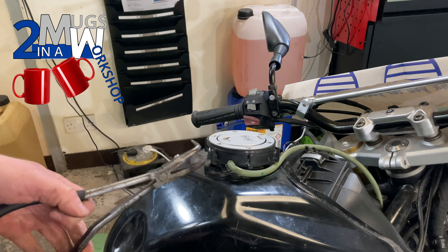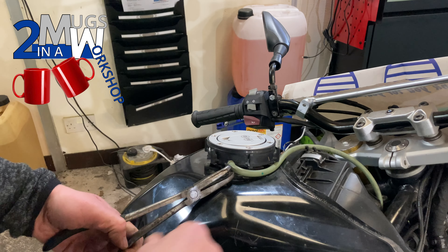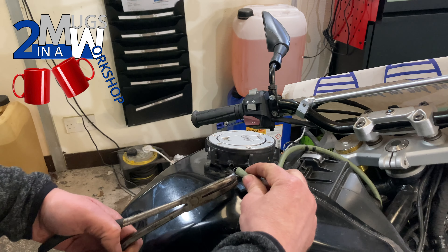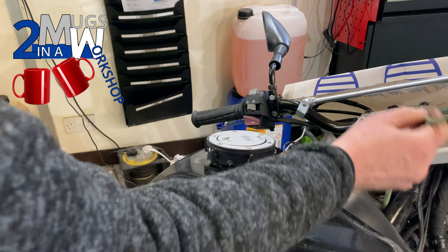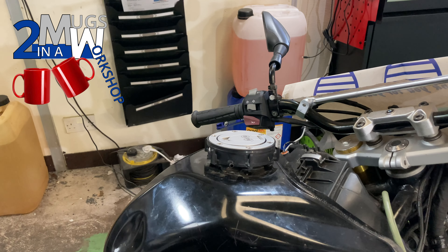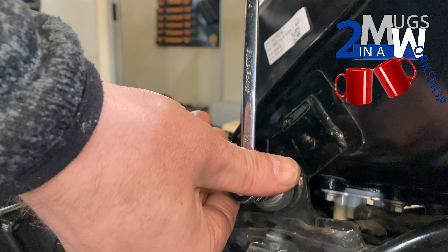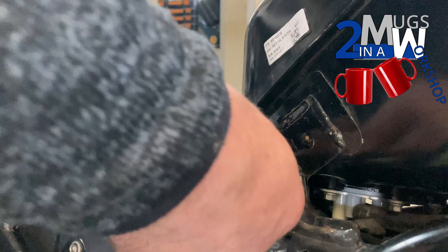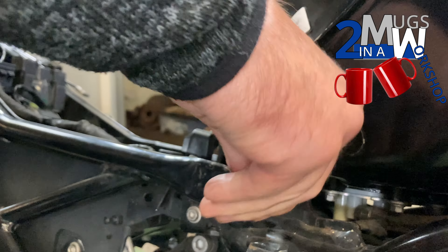Taking off the overflow pipe on the top — I've gone for these right-angle pliers, just grab either side of that clip, pinch it together, lets the clip go, pulls off nice and easy. That's the first part done. Now moving on to the bolts that secure the fuel tank to the frame — 12mm. Just found out 13 will actually fit on it quite nicely, but they are actually 12mm, slightly different sizes to a lot of the bolts we use around here.